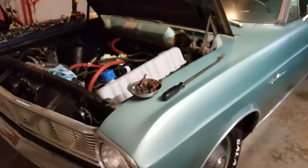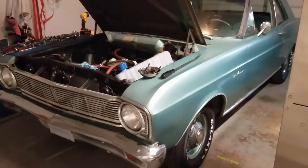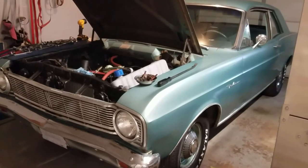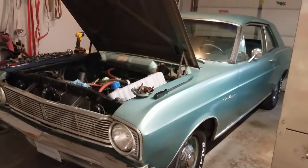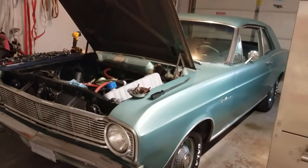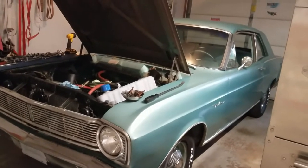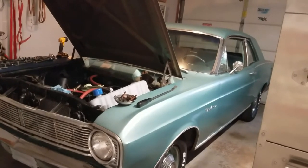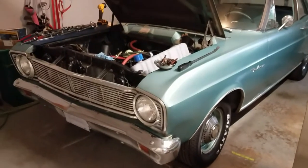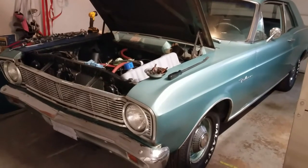Anyway, that's some progress on the car. We're just trying to get it running. Looking underneath, it might have a leaking wheel cylinder in the back. The brake line T-fitting on the rear axle is loose — the bolt snapped off. The pinion seal is leaking like a sieve. The automatic transmission doesn't look like it's been serviced in 30 years. So there's plenty more to do to make this thing trustworthy enough to drive around, but we'll get there.